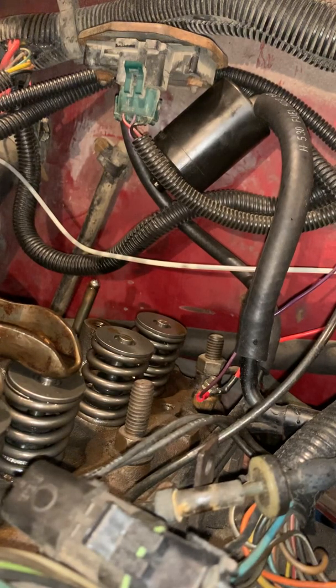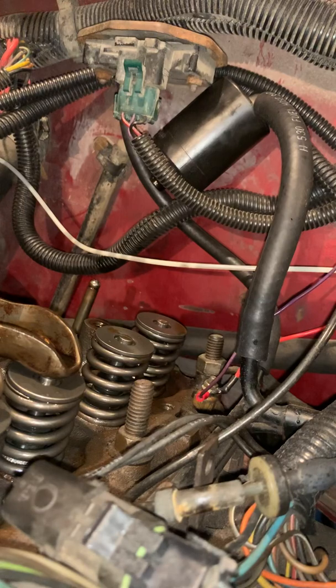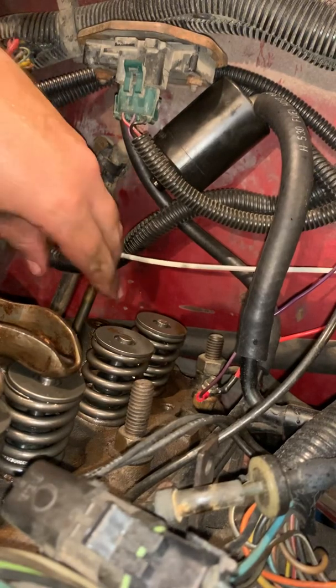These things, your rods. I'm gonna pull the rods out, make sure everything looks good on them. They have a little hole in them, so that you can get oil passages through it. You'll make sure that those are nice and clean as well. Right now I'm just kind of wiping them off with a towel. I'm going to blow on the end of it, get all the oil out, and make sure it's a nice clean passage. And again, I'm setting them next to each one that corresponds.